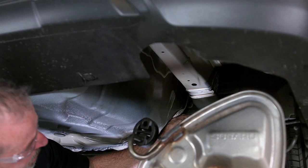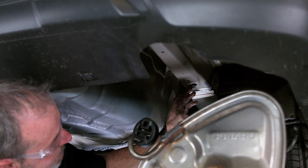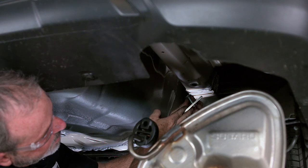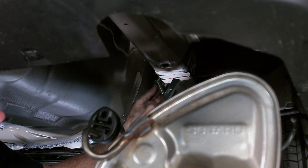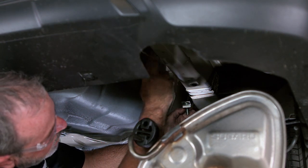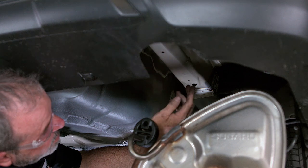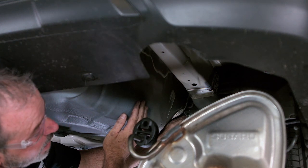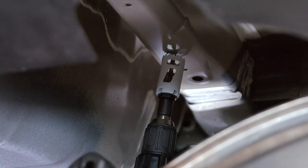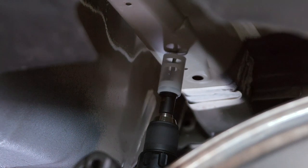Now that we have our attachment points exposed, we need to get our hardware inside the frame down through the hole so we can put our hitch up and bolt it down. This plate goes in here. Most vehicles are going to have some type of access hole down the frame that you can fish-wire a bolt buddy through, but on this vehicle it just doesn't exist on either side. So we're going to have to make our own access hole, going about two inches back of the exhaust heat shield bolt in the frame. I'm going to use an inch-and-an-eighth hole saw.